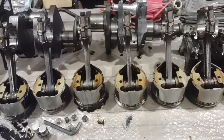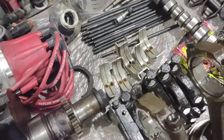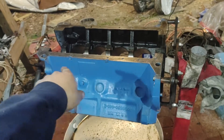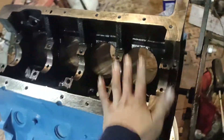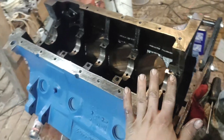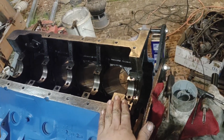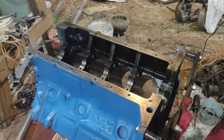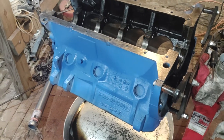I'm also going to open up the oil passages in the bearings. The bearings are in perfectly good shape so I'm going to reuse them, and I'll punch them out to match the enlarged oil galley holes to make sure I still get full oil flow. So that's a bit more in depth about this motor. Stay tuned — I'm going to keep putting stuff out as I work on it, and hopefully y'all get to hear it run this season. Life permitting, we shall see — thank you all for watching.